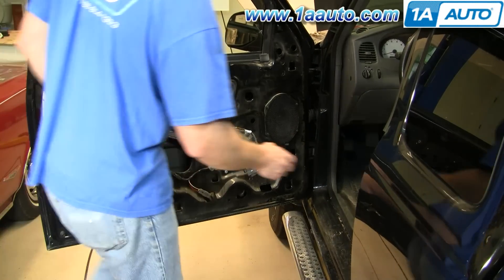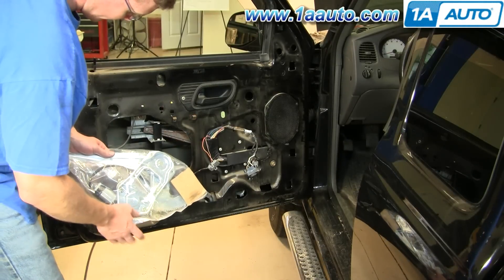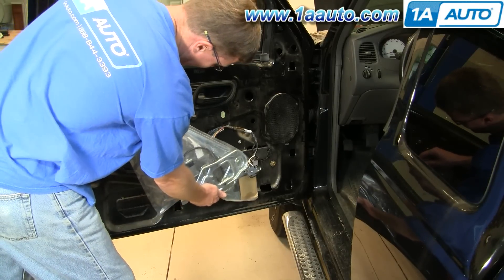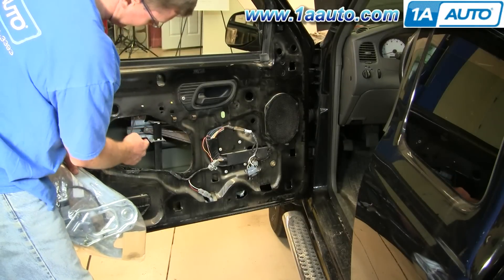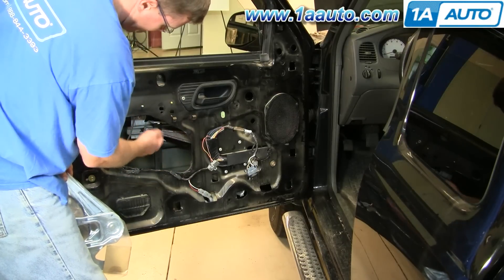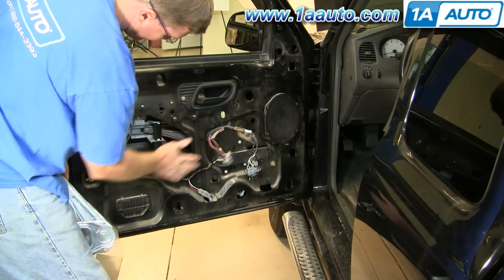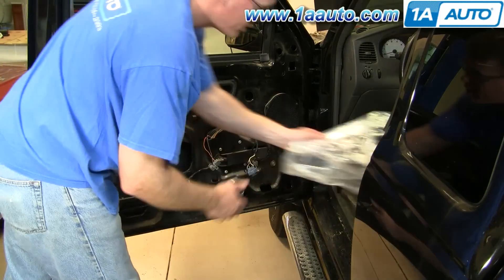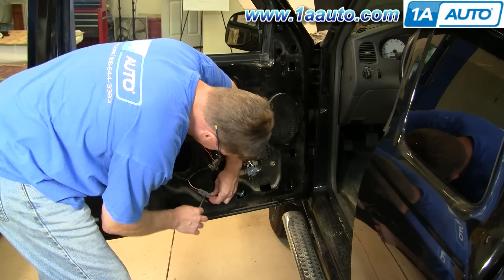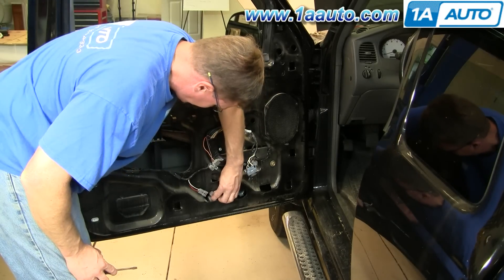If you're looking to replace your window regulator, I've got a new one here. You can see it is fastened with four rivets. It's basically in there like that, with the arm attached to the window. What you would do is drill out these four rivets using about a three-eighths inch drill bit. Drill out those rivets and then support your window — you'll probably want a helper to hold the window. Then slide the regulator out. It disconnects right here at the window motor connection — just use a screwdriver, pull this little tab and disconnect it.